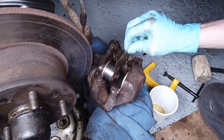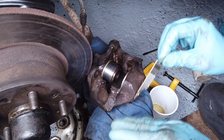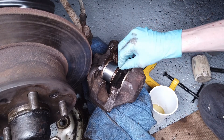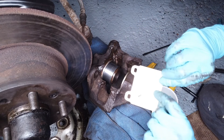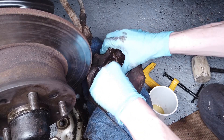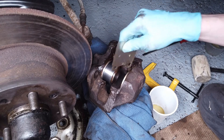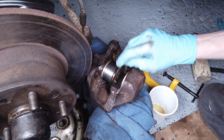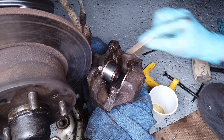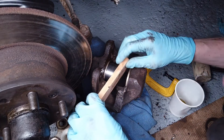Note that the caliper is upside down here, so remember this is actually the top of the backing plate where the pins will go through. The tabs are supposed to sit in there engaged with the lips on the piston. Interestingly, the piston on the other side that we haven't taken out yet is actually oriented completely wrong, so it's a good thing I didn't go off the photograph I took earlier to reassemble this. Just use the backing plate as the source of truth.